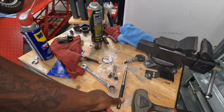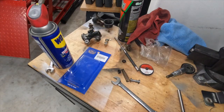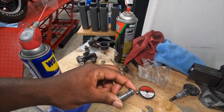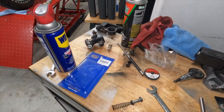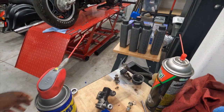This is the part I am beating up against. There's no spring at all — it's just stuck, it's seized. The rear master itself is 100% bad. I tried to get a universal master cylinder but it didn't really work. Then I got a brake rebuild kit and as we can see it's not rebuilding much. I'll have to find a used one online and rebuild that one.